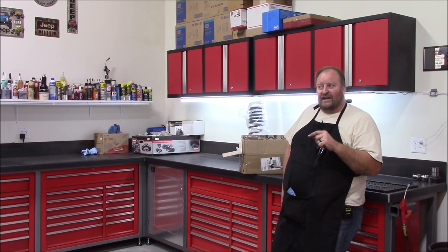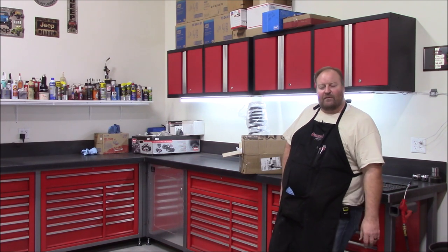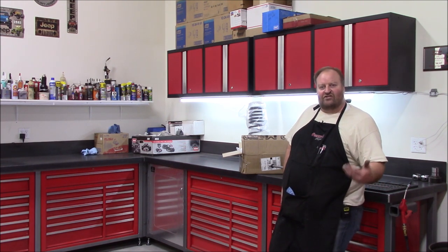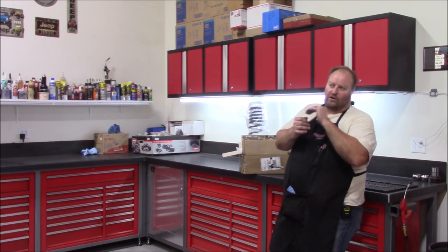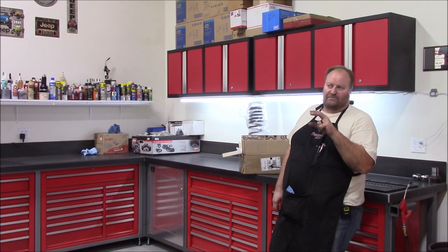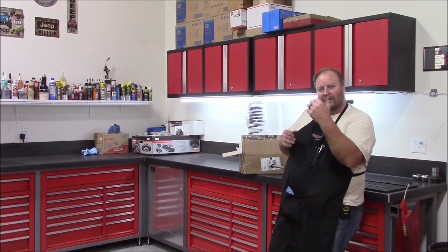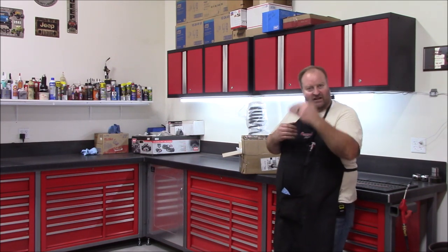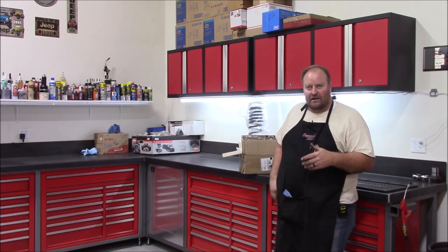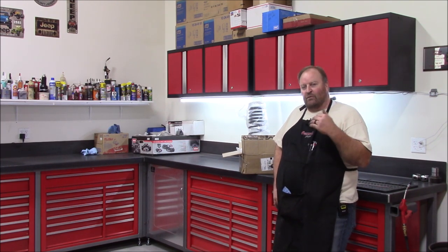But when I did that lift kit, I put on what is called JKS ACOS. Many of you may be familiar with these. An ACOS is an adjustable coilover spacer. What they do is you cut the lower portion of the bump stop or jounce stop bucket off. These slide up over that tube into position and provide some adjustability for weight changing. My thinking was I'm going to be changing this thing quite a bit over the first year or two, and I wanted to have that adjustability.